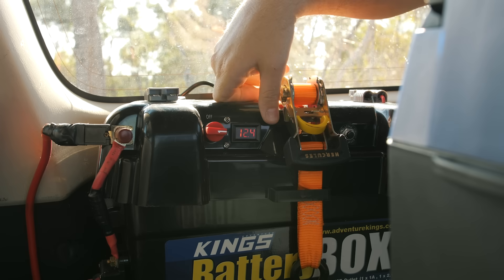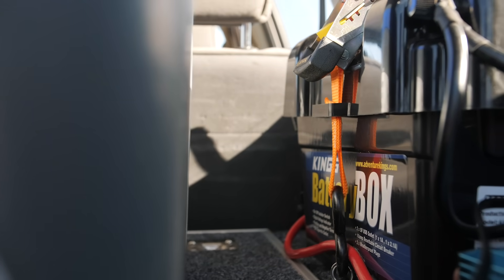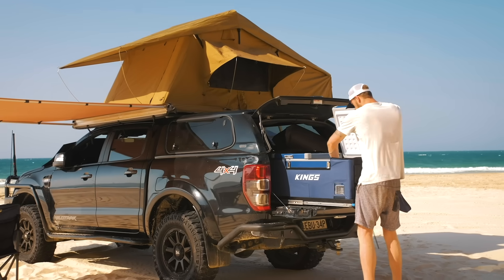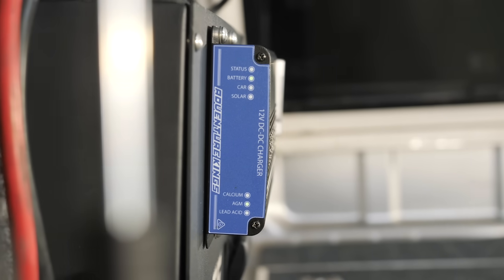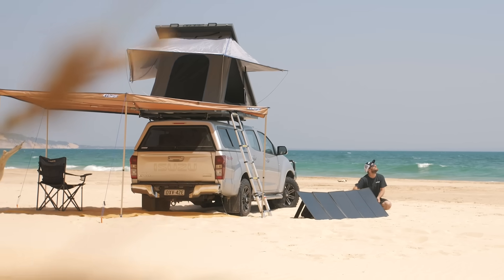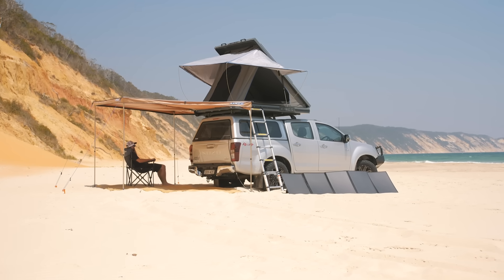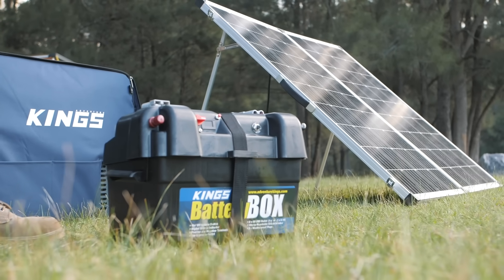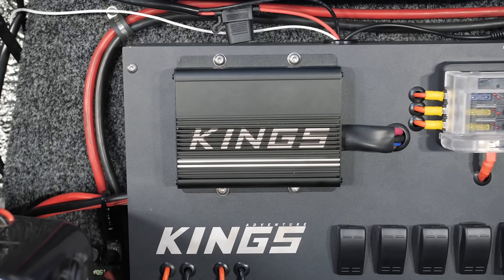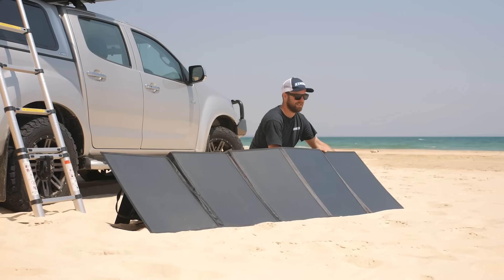Whether it's due to the battery chemistry needing a higher voltage than your alternator can provide, or whether the battery location means voltage drop will make charging inefficient, they're also particularly important if you've got a smart or temperature compensating alternator. At the end of the day, your dual battery system can be built in a number of ways, but a DC-DC charger combines a lot of the features you need into one unit. It'll always charge your battery more precisely than a basic system, and some give you the option of plugging solar directly in too. Do your research and decide which setup is right for you — whether it's a separate battery in a box that you charge with solar and top up at home, or a completely permanent multi-purpose DC-DC charger that means you never even need to think about your auxiliary battery. You just know it'll charge your second battery properly every time, whether you're driving or connecting your solar panel directly.